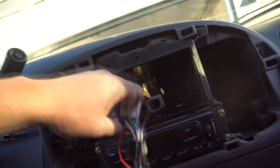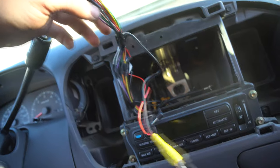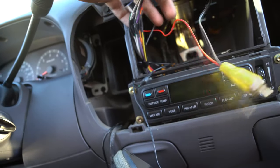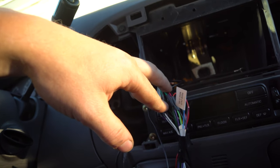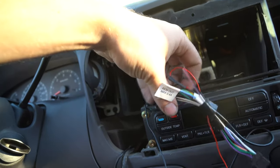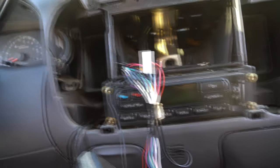You'll see you have this harness. If it has a ground on it, I would suggest you ground the camera back at the rear of the vehicle — you always want to get the ground close. For power, you want to wire it to the switched accessory so the camera isn't always on. If you wire it to the yellow wire, the camera will always have power, so make sure you use switched accessory.